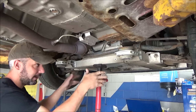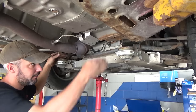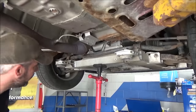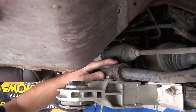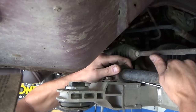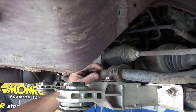This is how I've always done them — I don't want to unhook anything up front, just leave the engine everything hooked up and just lower it down. You don't have to worry about your steering shaft coming disconnected or anything. Lower it down about three and a half, four inches, pull your insulators off, and now you've got plenty of room to work. What we're after is these little saddles that hold the sway bar on. Stick a 13mm on there, get them cracked loose, then buzz up in here with an air ratchet. Take both off, both sides obviously, and slide it out — it's a pretty easy job.